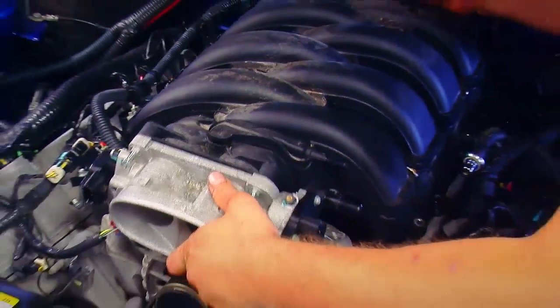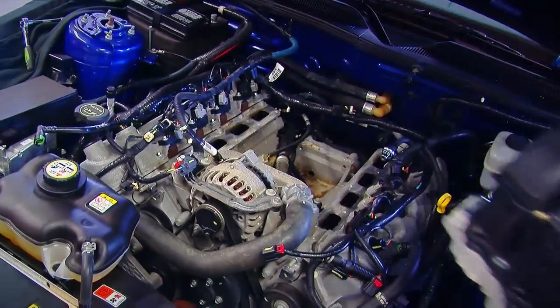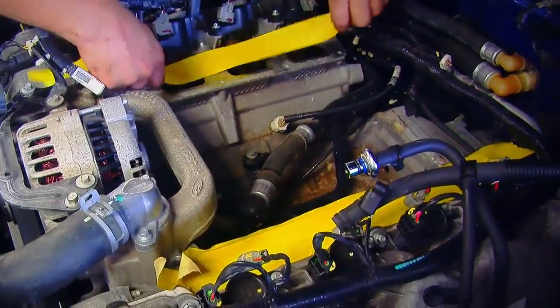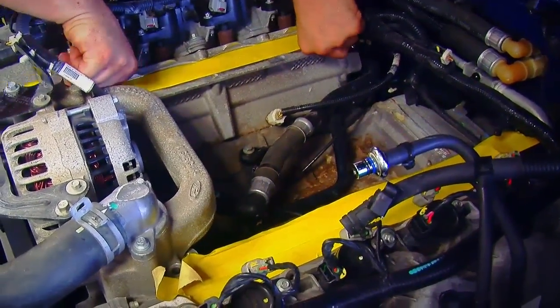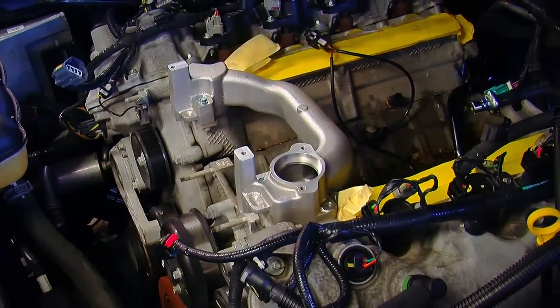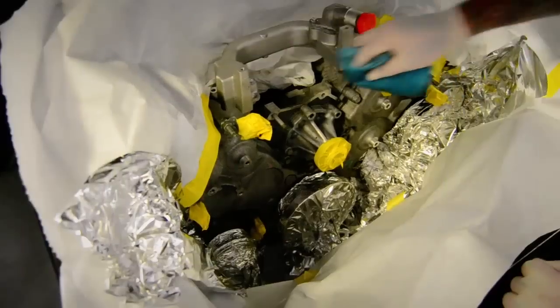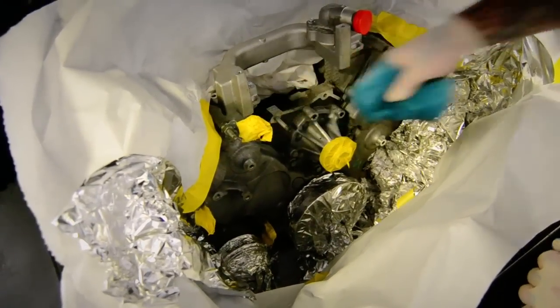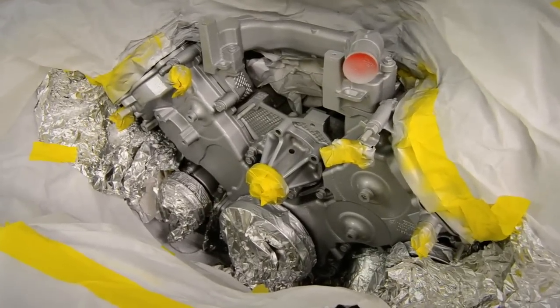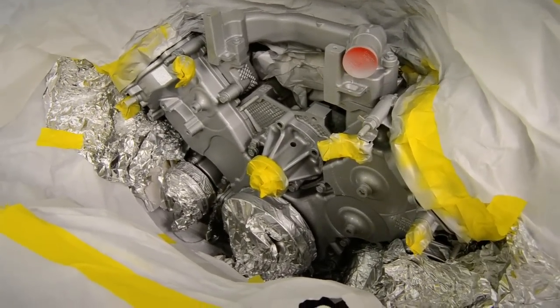This car is as much about looking good as it is about going fast, so we took the opportunity to do some detail items under the hood. The main thing is these engines are all aluminum, which looks great when new, but aluminum tends to oxidize pretty quickly and then it starts to get that grainy, dingy kind of look. So on aluminum engines and parts we've been using Eastwood's ceramic high-heat engine paint — really nice stuff — in an aluminum color, so we clean them up and respray them to make them look like fresh aluminum that will never oxidize.